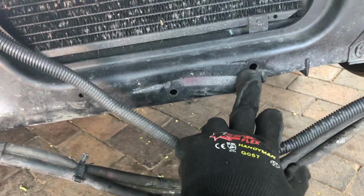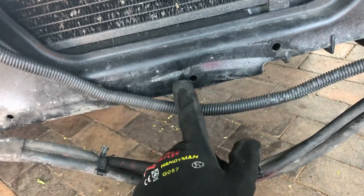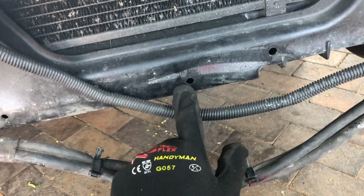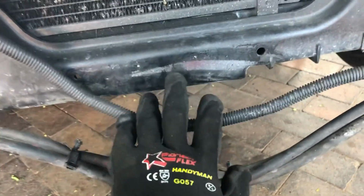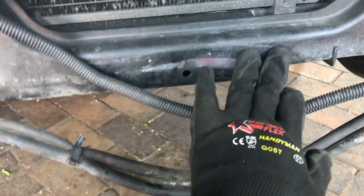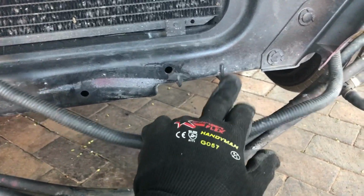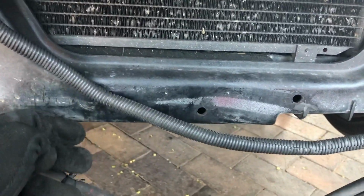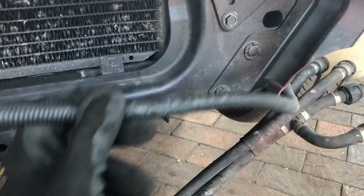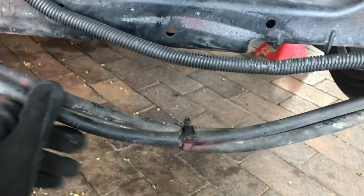So I've been fiddling with nutserts, but I don't have the gun to compress the nut, so I was thinking if I hammer it in and try and turn, hopefully there's enough torque to get it to collapse. But this being this fiberglass composite whatever, it just turned itself loose. So we're going to make a bracket now that's going to fit in here. I've already shaved down these pieces here because they were getting in the way. Building a bracket that's basically a 90 degree, it fits in here. I will figure out how to reroute the harness, either over the cooler like this or underneath. We'll still see. And then, yeah, these hoses as well.